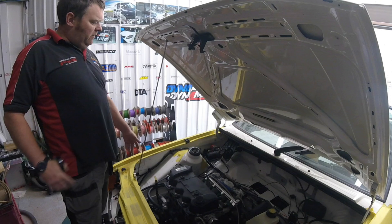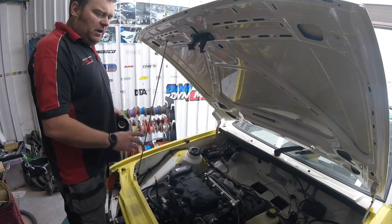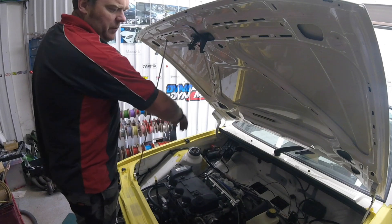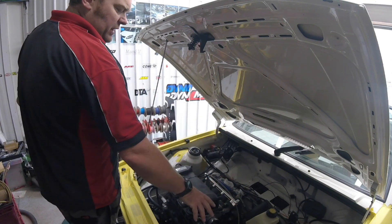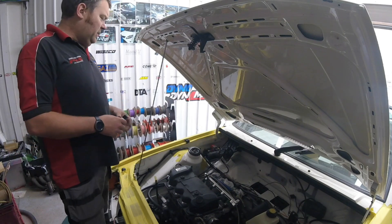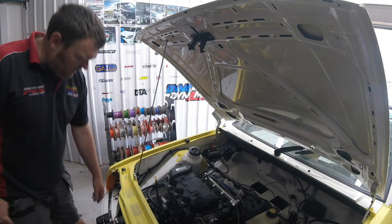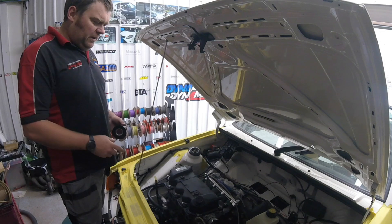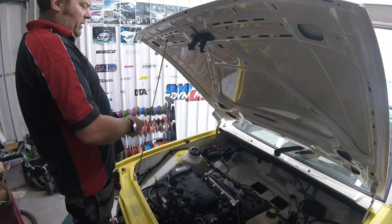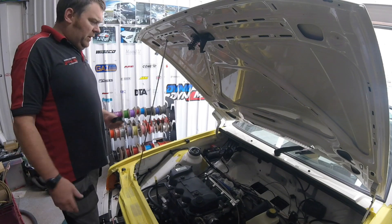I'm going to finish up this video here. I've wrapped this side and ended up pulling a few more cables back around to the main part of the loom along the bulkhead — including the washer bottle, because it'll look neater to come round with the rest of the wiring for the ignition coil. That'll keep a cleaner engine bay. All this is now loom taped up. We're using non-adhesive loom tape on this, which is kind of how they would have been originally. I've left some tails longer than I need so I can put the connectors on the ends, and I've got all new connectors for the headlights — but I'll finish that up in the next video because this one has probably gone on long enough.